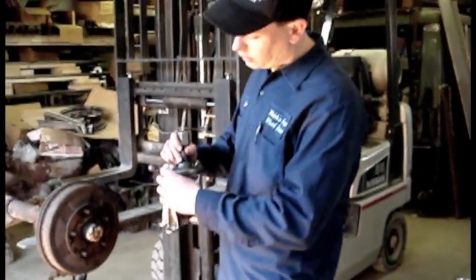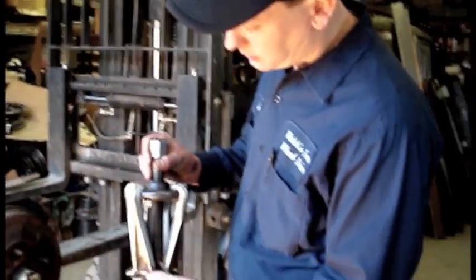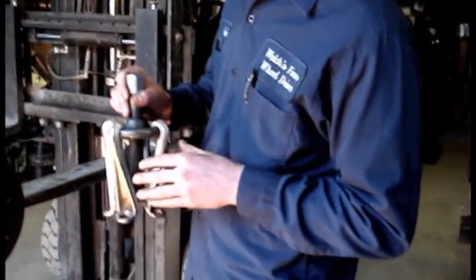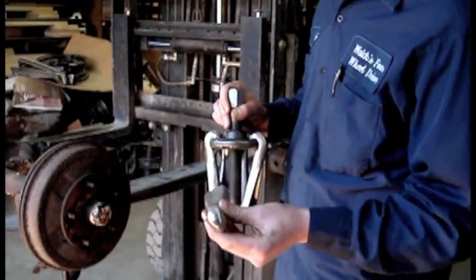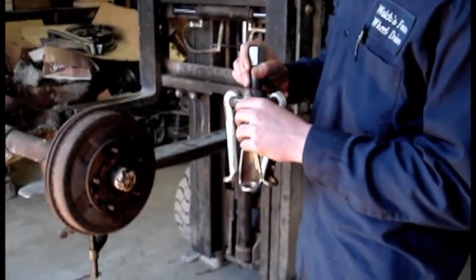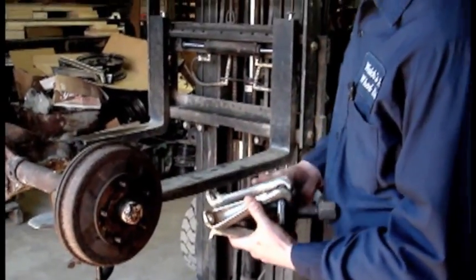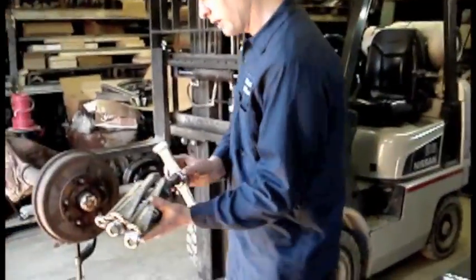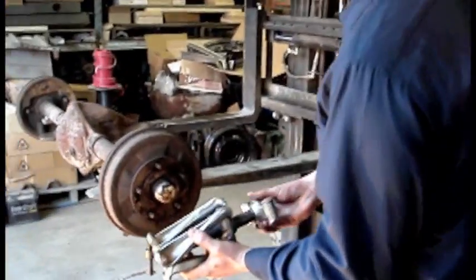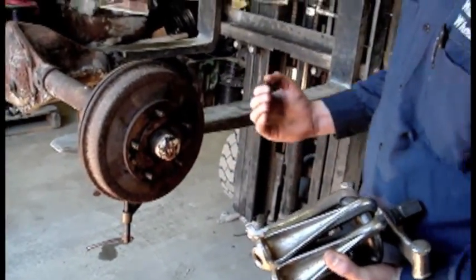This is your typical hub puller, actually from OTC tools. When you buy it from them, they're a three-lug puller, so you can buy the extra two legs — they slide on and lock on. Once it's on, you're going to beat on this. There's a little arm that goes on here and you beat on it, and it's going to push on the center of the axle and pull on the drum and hub at the same time.